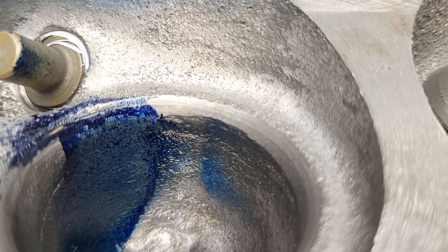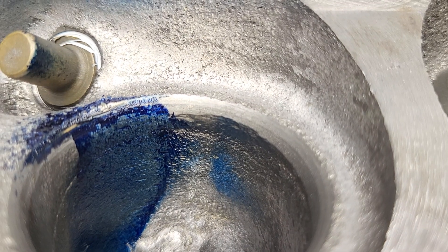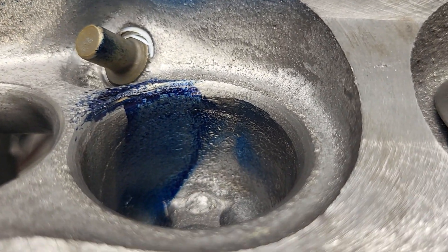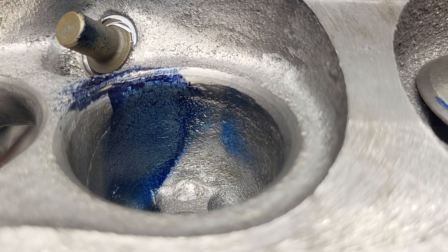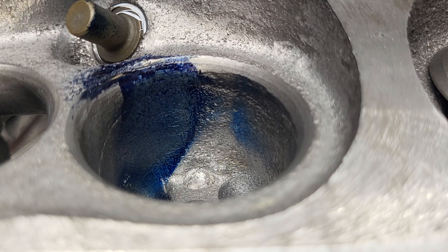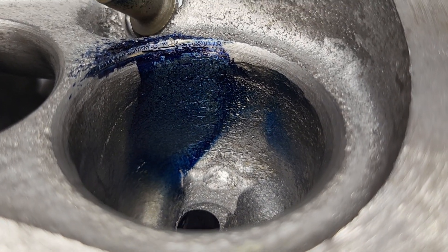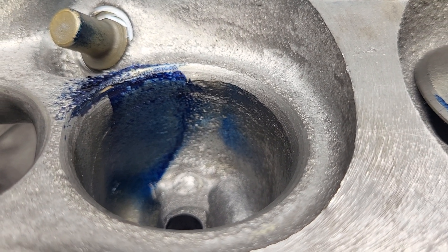You can see the valve job is not a thing of beauty — it's not supposed to be. It's supposed to be as high as I possibly get it right now, and I'll work my way in from there. You can still see there's a paste ooze line on that inside wall. These walls are not nearly as thick as I was thinking. A regular E7 is usually 200–250 thousandths. It looks like they made these ports a lot bigger but didn't add a ton of cast iron. The short side is quite thin.